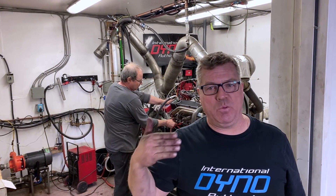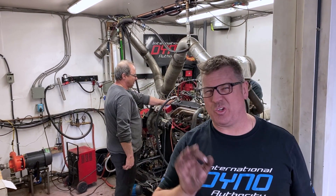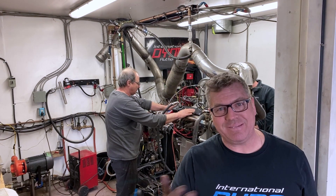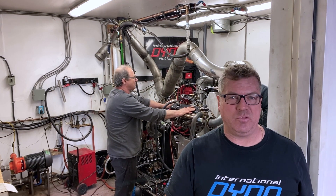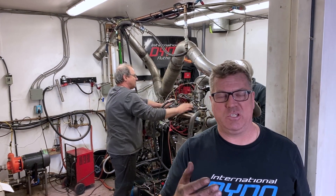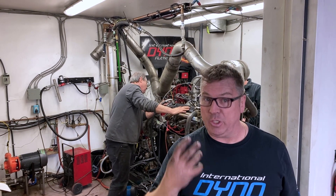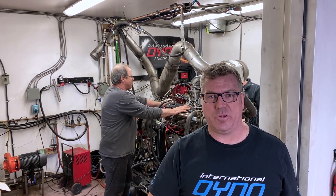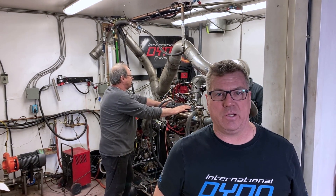We've made one pass — just a warm-up pass to put a little heat in the motor. Motor is starting and running good, but there's too much fuel. That's why they're here — to find out how much fuel they actually need. It made quite a bit of boost but the engine temperature really didn't come up. The EGT should be somewhere around a thousand but it's only around 600, so we're going to make a fairly good-sized jetting change — the return pill will return more fuel and not push quite so much into the engine.